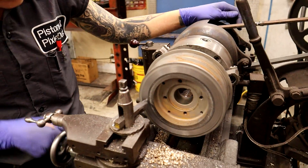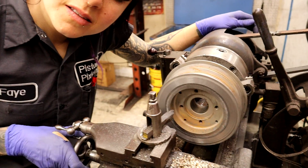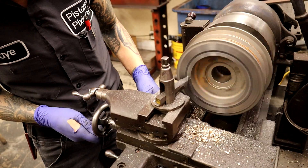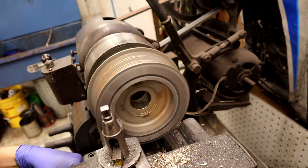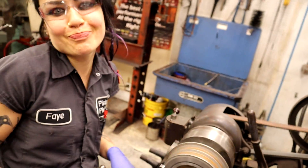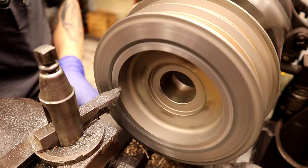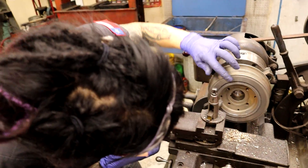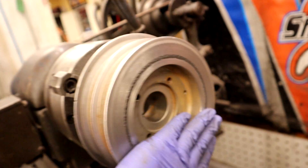It was already cool, but now that it's perfectly parallel it makes balancing a lot easier too — being a little off matters. Then right when you go past it, go just a little further and put a nice little chamfer on there — just go into it and let it cut, very little. Now you're going to lay it to cut everything off. I love the little attention-to-detail stuff. Oh, that looks so nice — it looks like it was made that way from the factory.